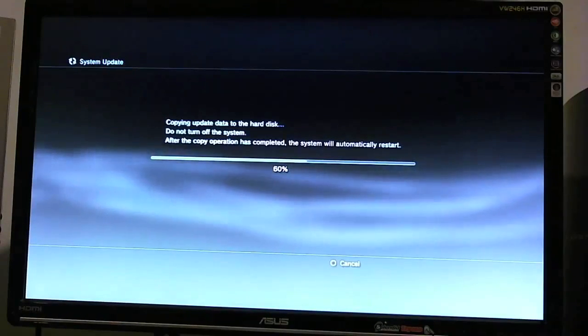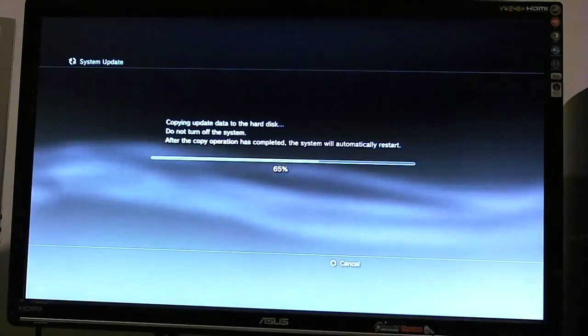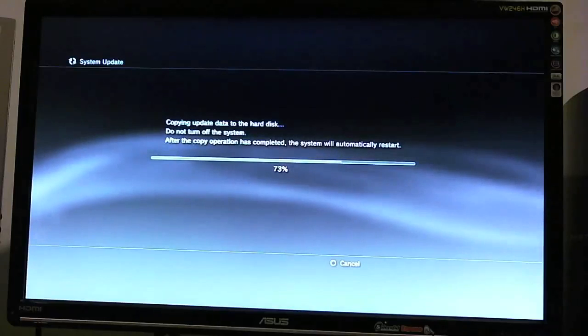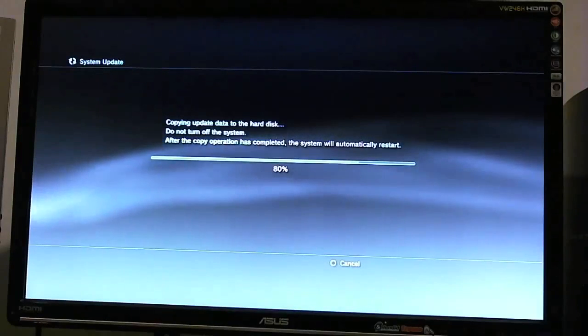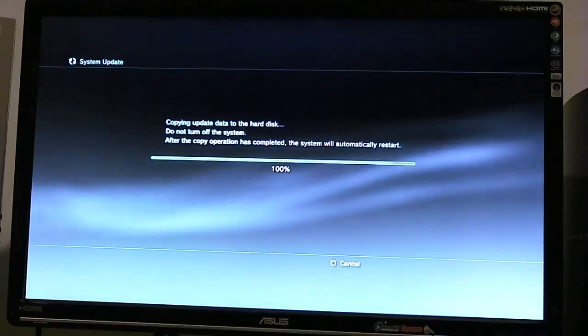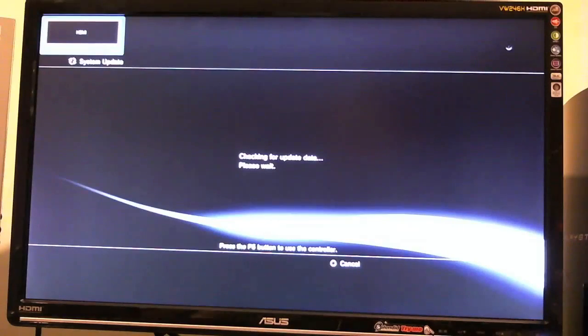You won't need that official 3.55 PUP I showed you guys. In order to get the PS3 into recovery mode, you turn it off with the switch in the back, or pull the plug if you're on a slim, turn it back on, and when you go to turn it back on, hold down the power button until it shuts off again. Then lift your finger and push it down again. You'll hear one beep, two beeps, and then a double beep. After that, you'll get into the PS3's recovery menu. From there, just go ahead and go to restore, and it should restore you to the regular 3.55.